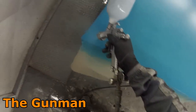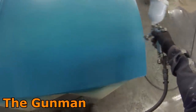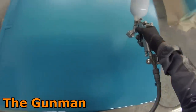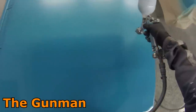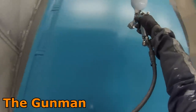This no-mix base coat is one-to-one instead of two-to-one. Most paint systems from my experience are two-to-one, so you basically get an extra 25% base coat out of this system — one liter of base coat turns into two liters rather than 1.5 liters. Combine that with the fact that it's already half the price of most paint systems and you've got yourself some very cheap paint. Price is always on everyone's mind these days, and if you're able to save without compromising the quality of the job, which I believe in most cases you are, it's probably worth giving a shot.